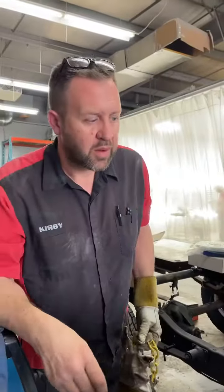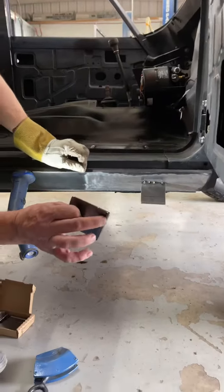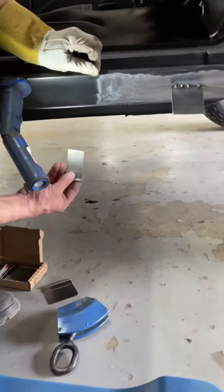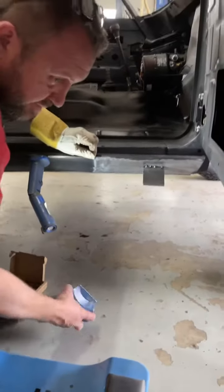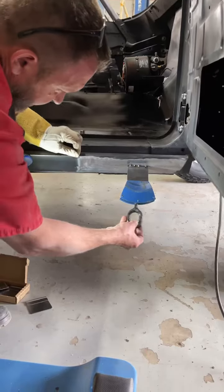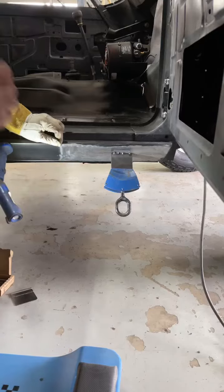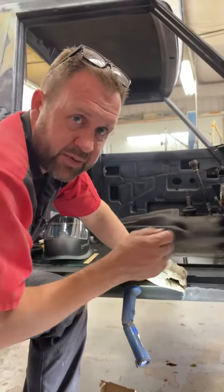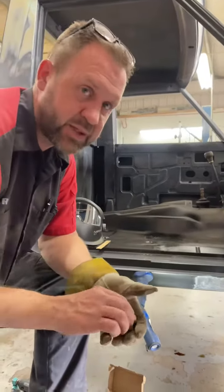You're doing a pull? Yeah, this is cool. We have these plates — they got a roll pin on the end. You have different widths, and of course you can cut them, shape them, whatever. So you tack that on. You have a big dent like that, it slides on, and then you can change the angle of this, move it wherever you want, pull at the right angle — do the opposite of the way it was pushed in. That way you don't get a million high spots like a bunch of nails. Just draw it all out together, stretch the metal at least enough.